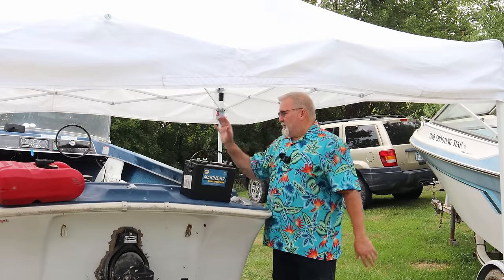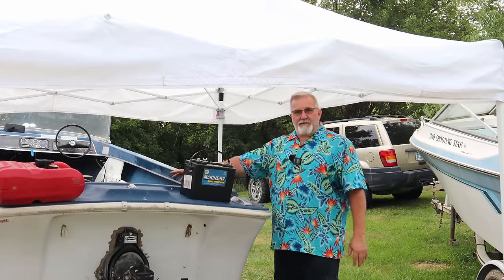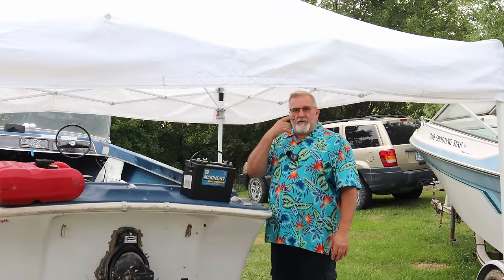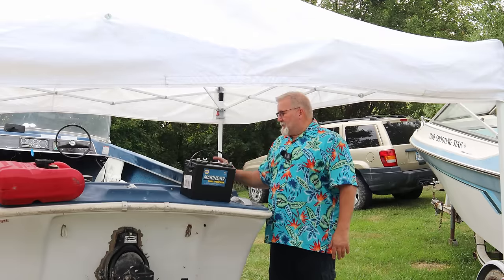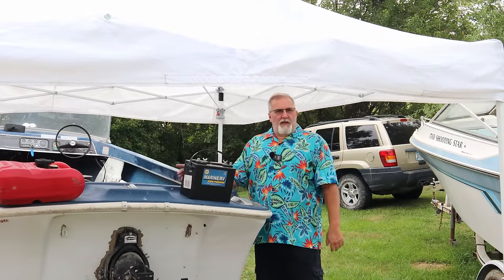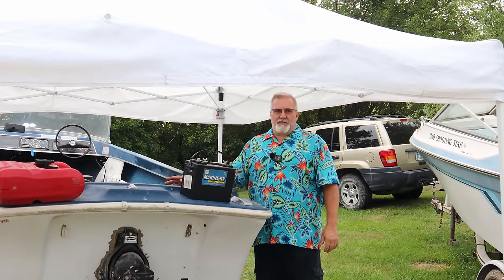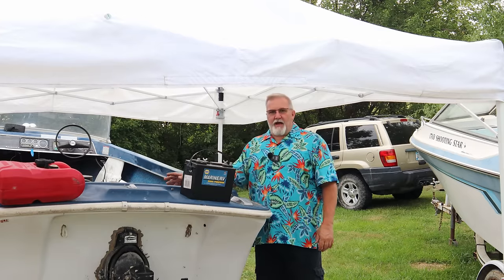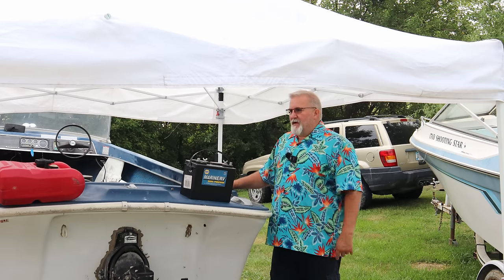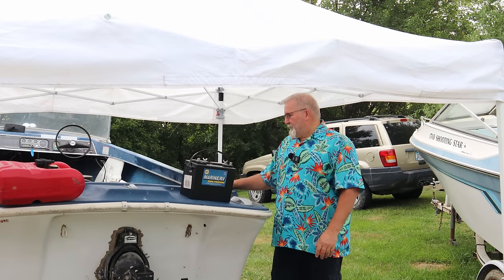And one of these days I'll find me a boat that's in really good condition that has a really bad motor. Somebody actually took out a motor. I've yet to find an Iron Duke that was toast that wasn't due to freezing. Usually what takes these out is improper winterization, and you'll crack a block and destroy the block. Unfortunately, that happens. I've run into one of those so far.